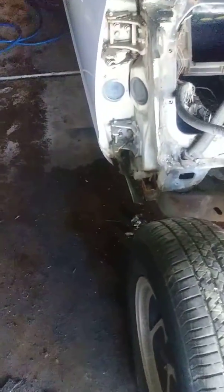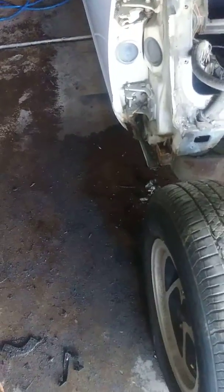Yep, a nice lovely dent that's going to be coming out anyway, because this whole panel here is getting cut out and having a new one put in because of the giant rust holes. Same thing with the other side. These doors are getting replaced because of the rust down there that goes all the way through the door. Doors aren't savable because of that, and saving them would be too much money. So I'm getting whole new doors for both sides.